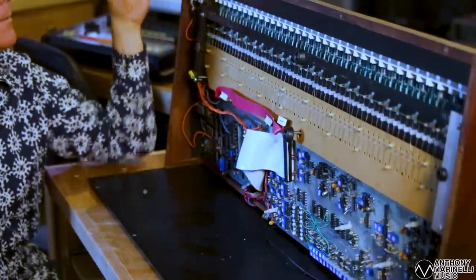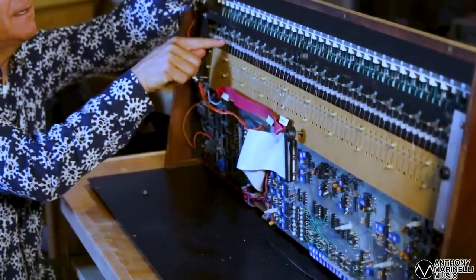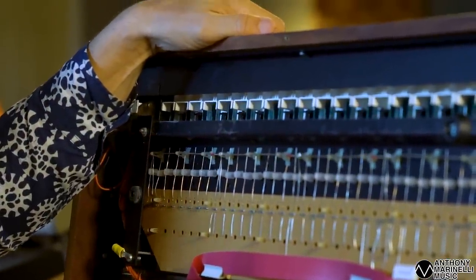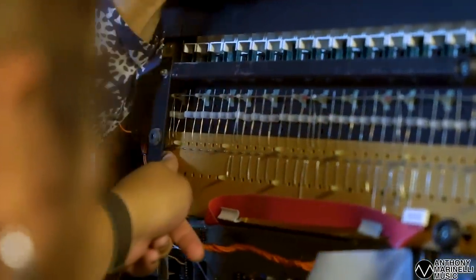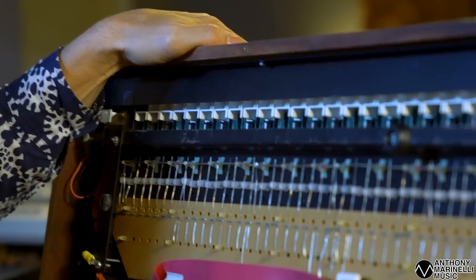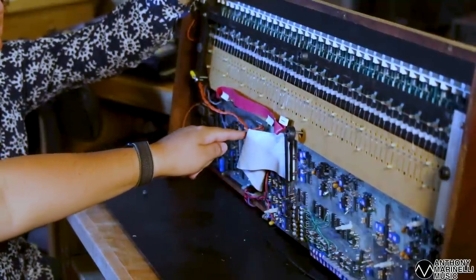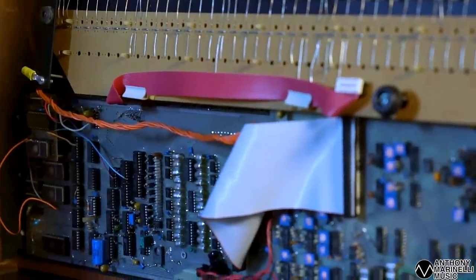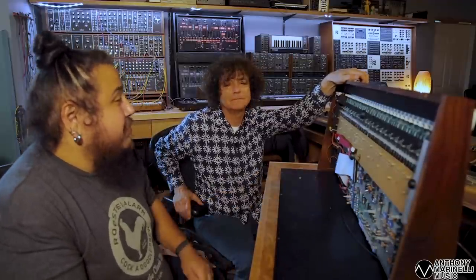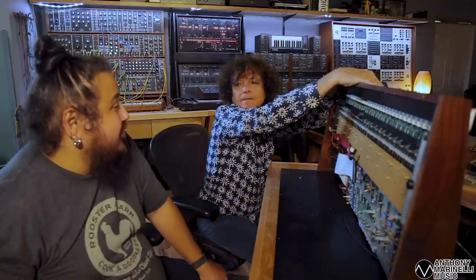These wires here are related to the keyboard depressions - they touch what's called a bus bar. Those are called J-wires, and they touch this bus bar. These are all in what's called a matrix - the first keys connected through a series of diodes to eight keys later, then these all have a common bus, one per eight keys. That converts into basically 16 different connections right here, and that gets bussed into the panel board which has a chip that just scans the keyboard for key presses and various combinations. That prevented them from needing 122 different connections, and it makes it happen in a scanning fashion - so you could theoretically go too fast for it to recognize your key press.